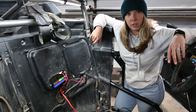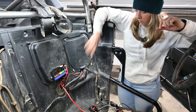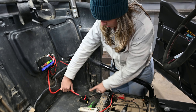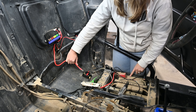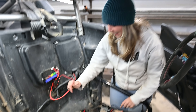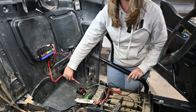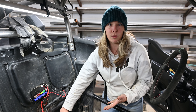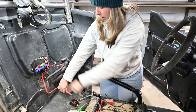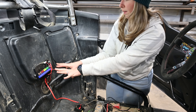Next step: power and ground cables. We've got to hook the power cable to the relay and then hook the relay to the battery. We got the ignition switch cable in, got the ground in going to the chassis, and everything is zip tied in. We put the relay right here. The only thing we haven't done is actually hook it up to the battery yet, but we did do a test to make sure everything is working right.